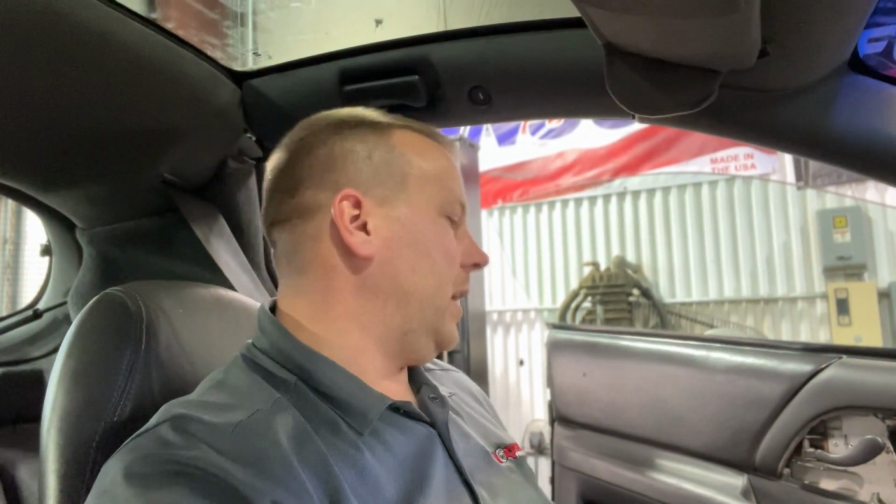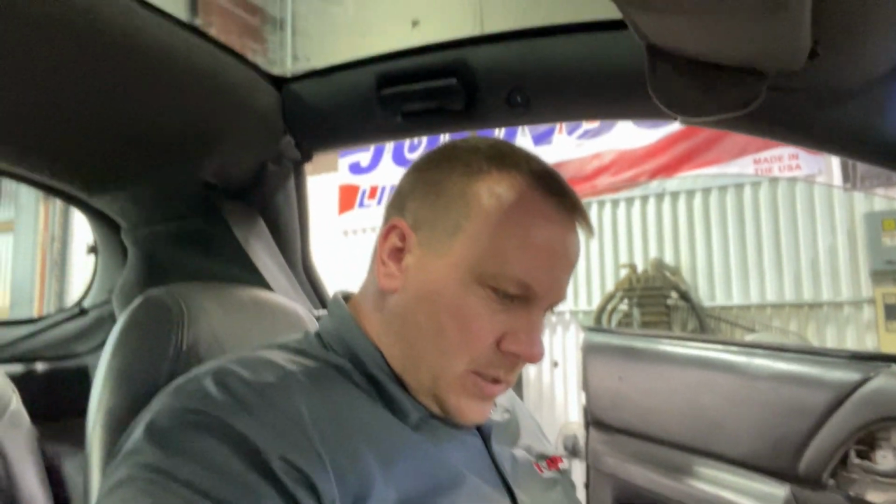So it ran 570 on 28 or 29 pounds, and then I turned it up to like 35, 36 pounds of boost when I finally torched the head. We didn't have good data on it because I torched the head, so it only ran like 4 seconds. At 5 seconds, it finally ate through the head, but it was going slower for 4 or 5 seconds straight. But I'm going to make a couple more runs and then I'm going to go home and eat because my head's still pounding.